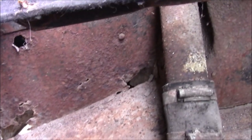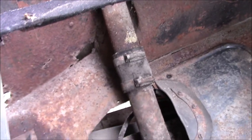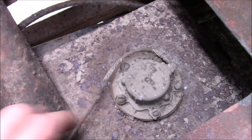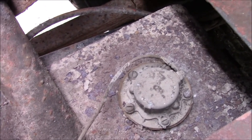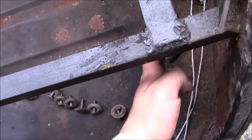I'm going to get the vacuum cleaner in here and give this a good clean. I'm not seeing any horrors that I wasn't already aware of — I knew about this rust, that's the worst bit we found on the car when we went to pick it up. I didn't really know about this pipe though — I have been smelling some petrol at the back of the car, and we were expecting to have to replace it. You can see it's just started to split. It won't be a problem at the moment as we're not driving it on the road, but before we do that will get replaced. You can much more clearly see the fuel line that runs to the front of the car down the chassis, and then this is your sender — that's the wire for that. This wire runs to the back of the car, around here somewhere, and then across and under the chassis. The tails come up through here for the rear lights.